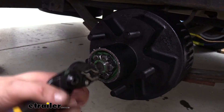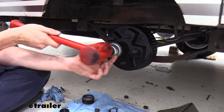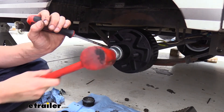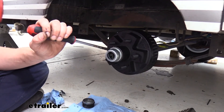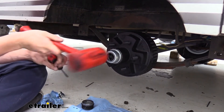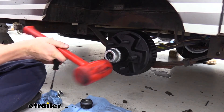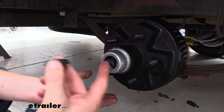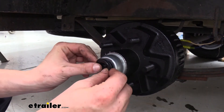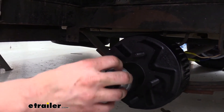We're going to bend the cotter pin ends back towards the center like they were before. We can now take our cap, set it in place, and tap it back on with our rubber mallet. If a newer cap is tricky to start, take a screwdriver on the outer lip on the side that's sticking out to get just one side to start, and it usually taps in pretty easily after that. If you had Easy Lube axles, you would want to fill those up until you see grease coming out of your bearings to ensure it's fully packed. For a standard axle, we just put the cap back on — grease inside the cap alone doesn't do any good.